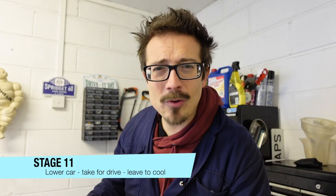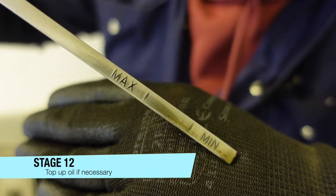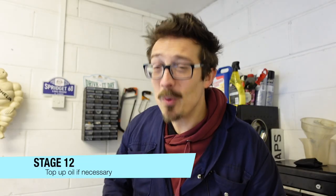She's down on the ground, I've run her for three or four minutes. I've also now taken her for a drive, brought her back, and she's been left cold overnight. We're going to check the dipstick now. The dipstick is showing clear oil because it's brand new, just below the max mark — which is utterly perfect, especially seeing as she's been sat after being run on a level surface. That's how to do an oil change — there's nothing more to it.